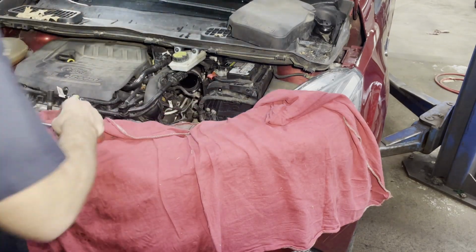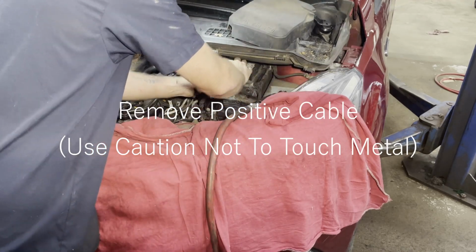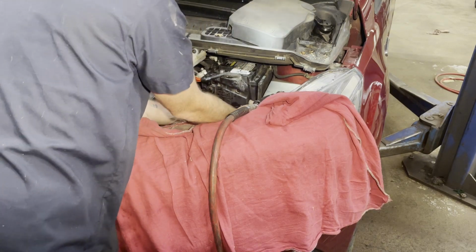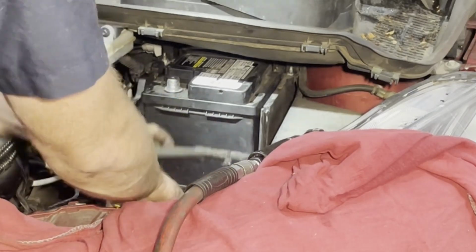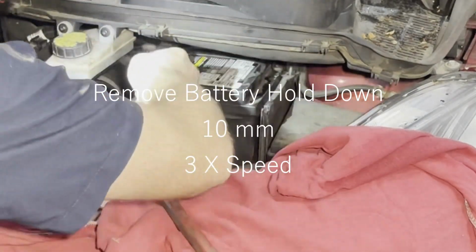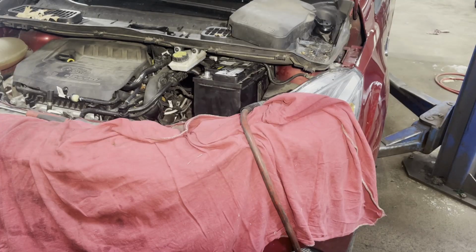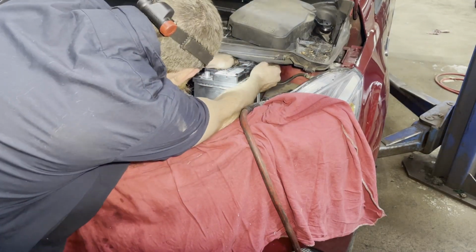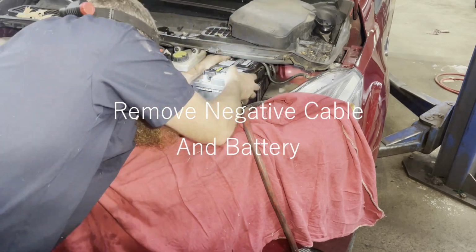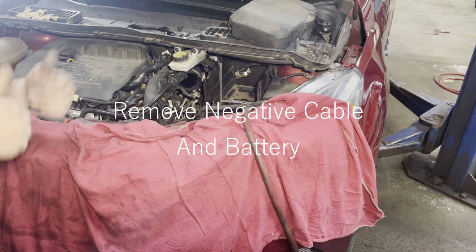I'm going to take that off and then slide that out of the way. Okay, a little more aggressive. I just do that, so now the battery slides right out this way. Remember that tab goes to the right. I normally use a gear wrench for that back ground battery bolt. Ground off, run your battery all the way out. Alright, battery's out. 10 millimeter.